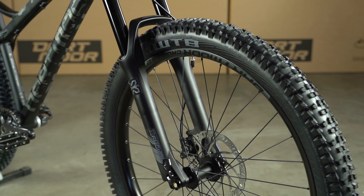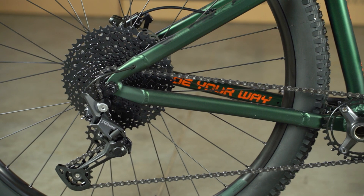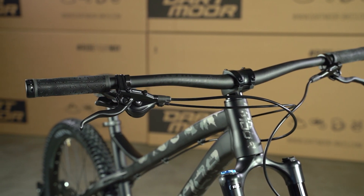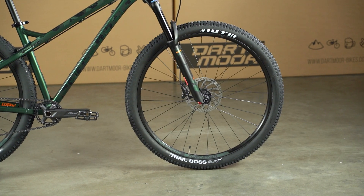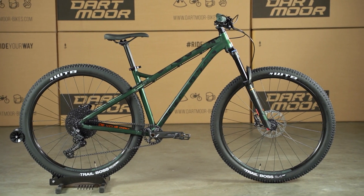Now let's switch to the Primal Evo. We go one step higher with the spec because we are using pretty lightweight and really good suspension forks from X-Fusion — the Sweep for 27.5 and the Slide for 29. For the drivetrain there is an 11-speed Shimano Deore drivetrain with an 11-51 cassette from Sunrace. For brakes, since we're talking about the Evo level, the model is also better: the Shimano MT410 brakes — already quite good brakes. For tires, it's again the WTB Trail Boss — 27.5 by 2.6 or 29 by 2.4.